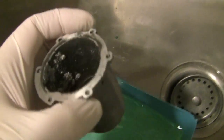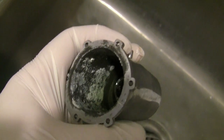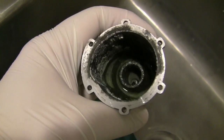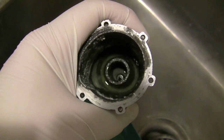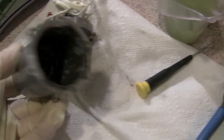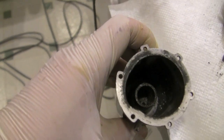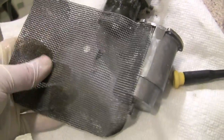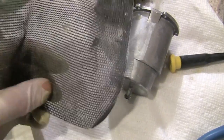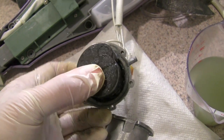So here is the inside of that heating cup, and you can see where there are plenty of mineral deposits from the water as it gets heated up and blasted out as steam. So after some judicious scraping and soaking in CLR, you can see I got rid of most of the deposits. I found that the mesh sandpaper you use for drywall worked really well because it's very flexible and doesn't lose its grit as readily. It doesn't get clogged up.